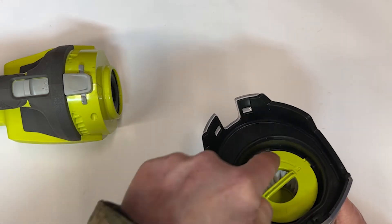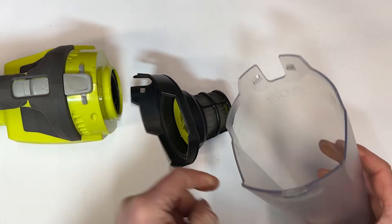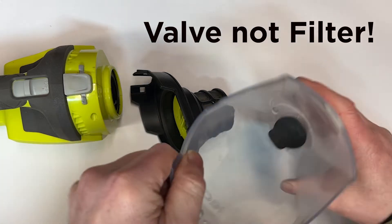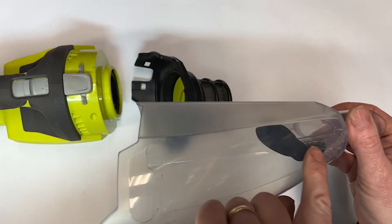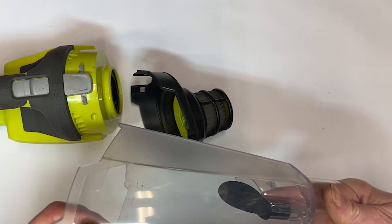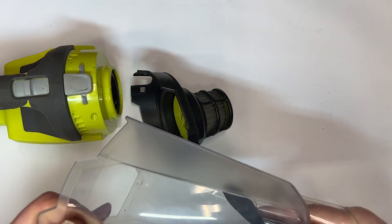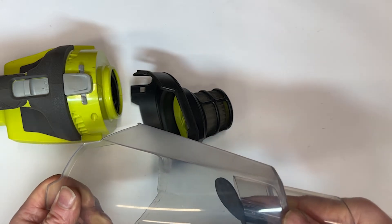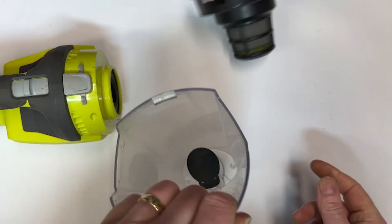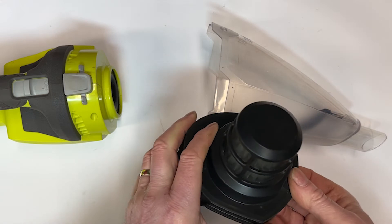That aside, there's your filter and nose unit. There's your HEPA filter in there — that assembly comes out. Any dirt or rubbish you've picked up, tip it out and put it in the bin. It's got a one-way valve here — a black tongue-like flap. It's a one-way valve: rubbish can be pulled in this way, and when you turn the vacuum off, that closes to stop debris dropping out. It's not 100% — it doesn't fully close, so if you set it down on a desk you might get some dirt dropping back out.